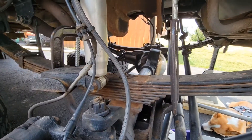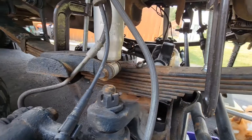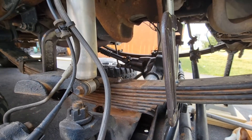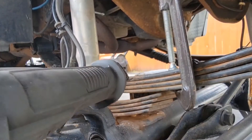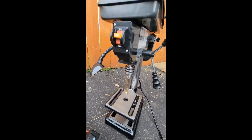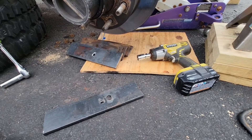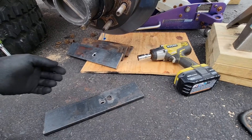What I've done here is clamped my main springs with C-clamps very tightly on the side. I'm actually going to take an angle grinder and knock off this bolt because I want to replace the center pin when I do this. That way I can make the new plate part of the entire leaf stack, which keeps it nice and legal so it's not a block.